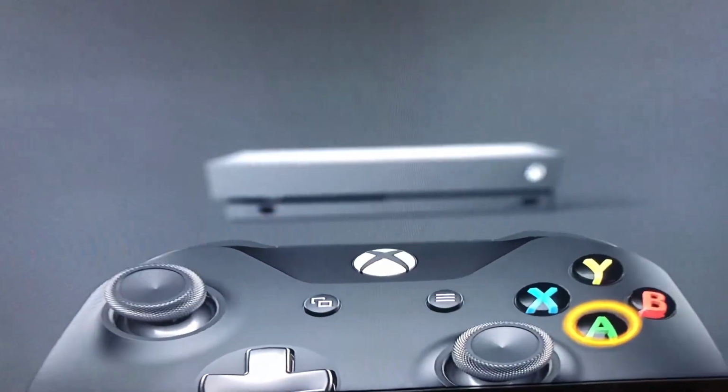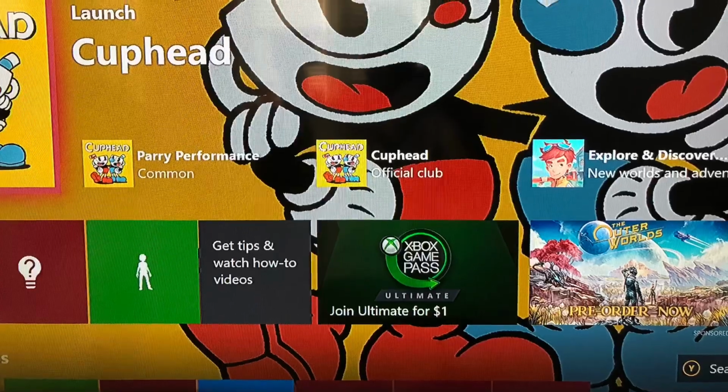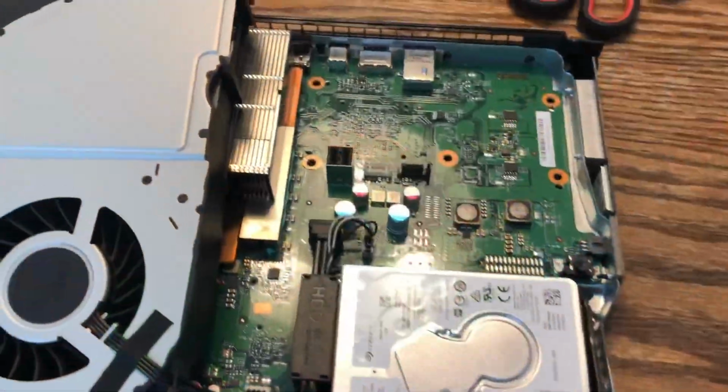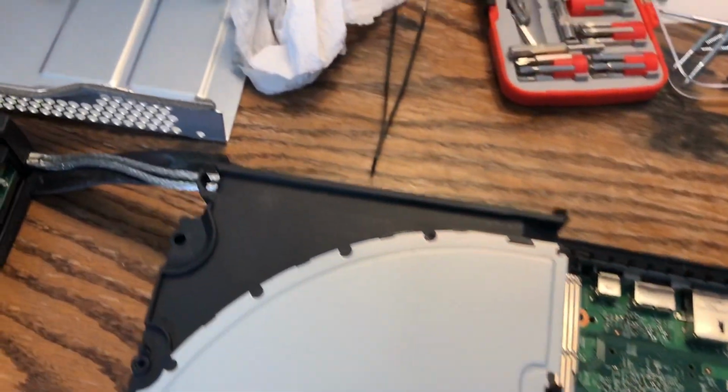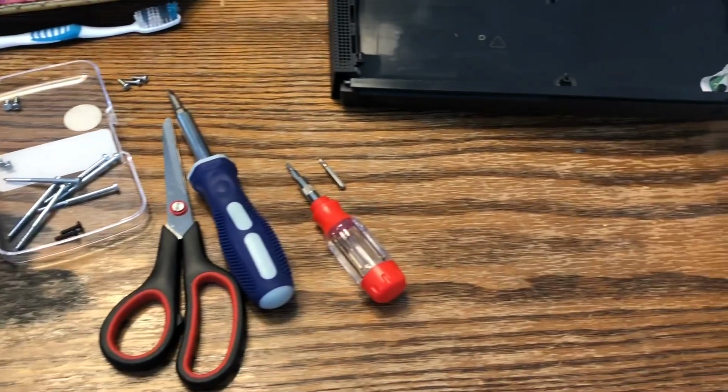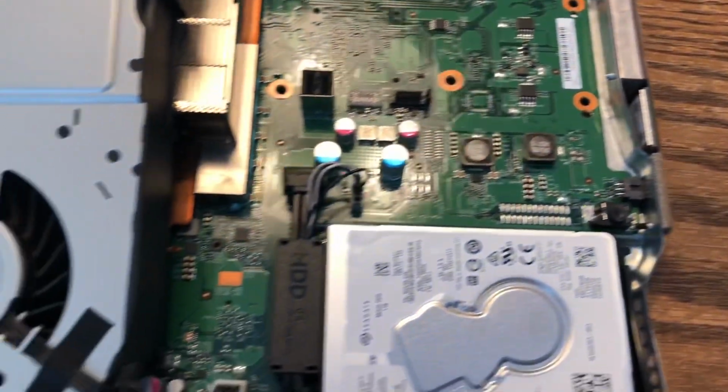It got me the latest update, and it appeared the console was booting up, so I was pretty excited, but unfortunately this only lasted about 2 days. The E102 and 105 error started looping again after I turned off the instant on feature, so I'm not sure if that triggered it or what, but the next time I powered the console on, it went through that loop,